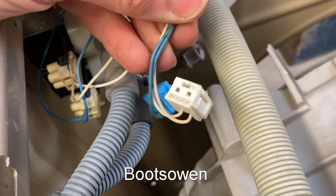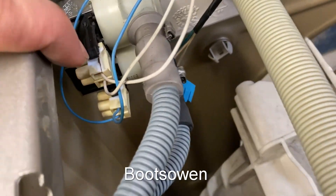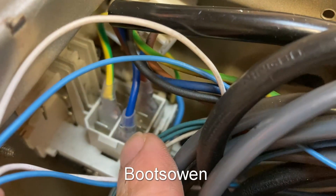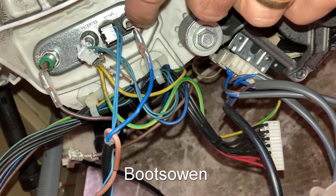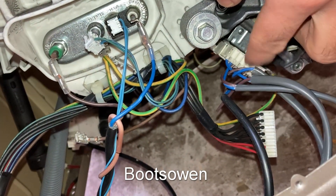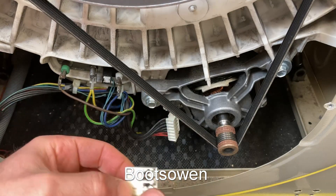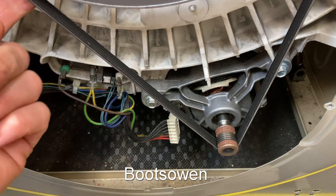Out of some kind of respect for the Indesit Moon, I've kept all the original connectors, so the complete wiring loom is original. I've used other things to make up a new wiring loom like strip connectors. I've replaced this block connector here with some spade connectors, and down at the motor and element I've used a combination of spade connectors that came with the kit and block connectors from an old wiring loom. This is the motor connector - I've disconnected it. I have a spare one that I've popped apart. This one's only got six wires but this one has seven, so I'll make up a new one with seven wires.